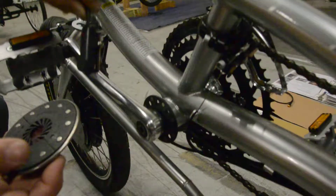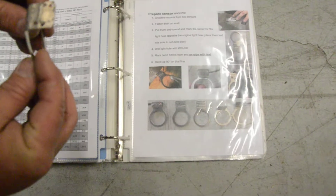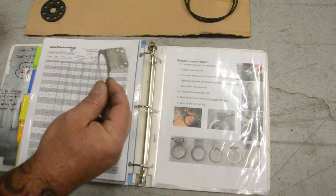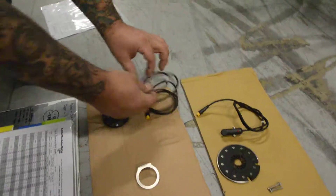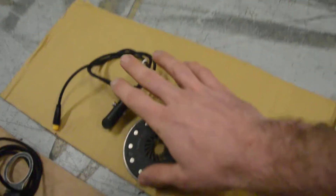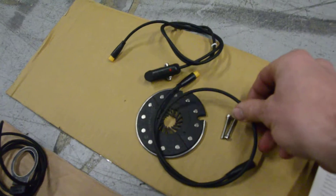It mounts in just a minute and we have a video specifically for that. If you want a more professional look, you can use our modified bracket, which we can sell to you or give you instructions for bending at home on your press brake, so that you can mount it directly to the bike and drill and tap the frame. But you have to use a special sensor and take apart the bottom bracket and the cranks — so that's a lot of work. Most people will use the regular sensor that we send with the kit and add an extension cable to give some extra length to reach the front of the bike.